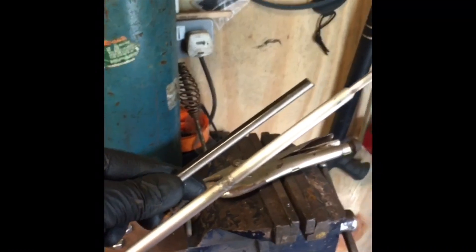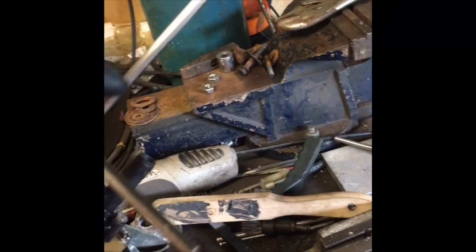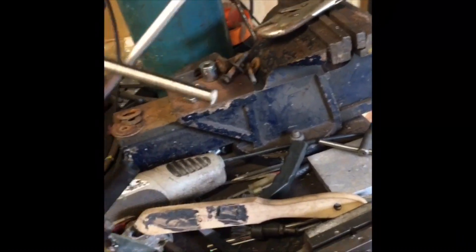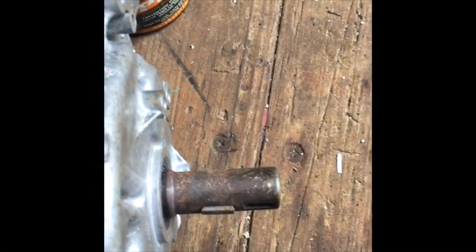This is the shortened gear shaft now and as you can see there's a section having been taken out of it — this is the exact length of the spacer that is removed from the lower unit. So now we can have a shortened engine shaft and this will still control the gears, and we will eventually then shorten the driveshaft as well. Here now we have the coupling from the driveshaft — the other end of it goes into the gearbox and it couples onto the crankshaft output from the engine. Here is the old bolt that was used to bolt on the mower blade.